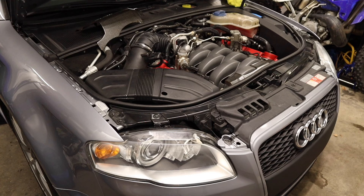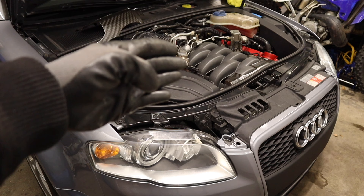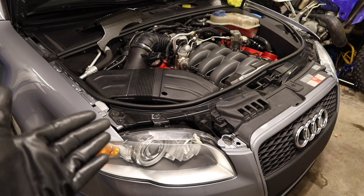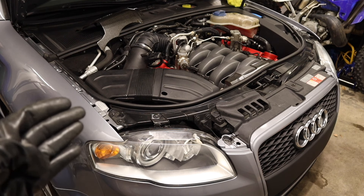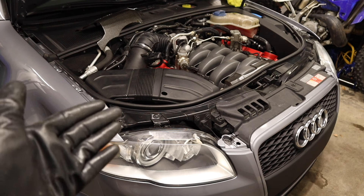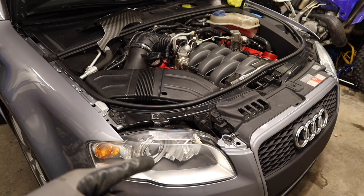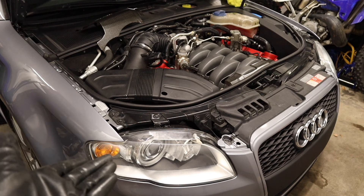Let's talk about carbon cleaning for people less confident in their skills. Putting the car in service position will give you more space at the front of the intake manifold to deal with all the sensitive stuff, although it can 100% be done without service position. You can get a tool to turn the motor over but it's expensive. One trick people use is the alternator bolt — you can access it to turn the motor over, but sometimes the belt may slip and you'll have to pull the belt and turn it at the same time while repeatedly checking.